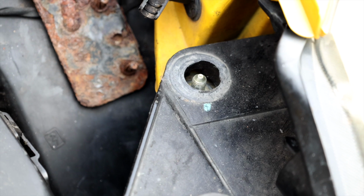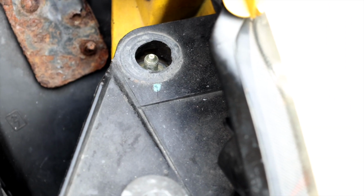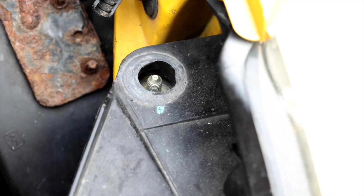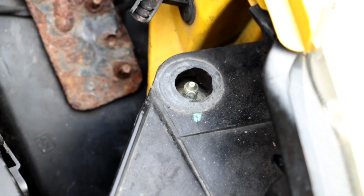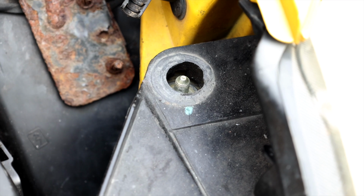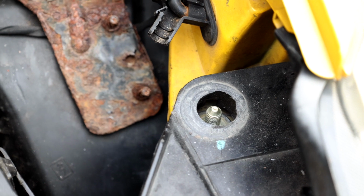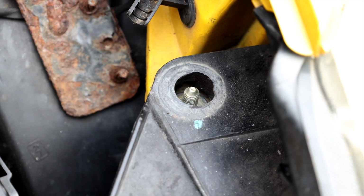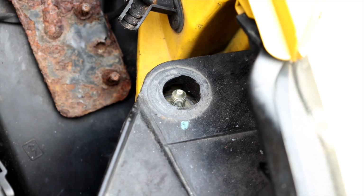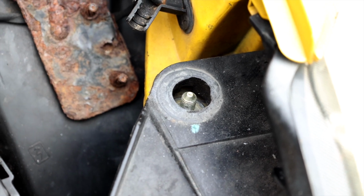Quite easily. But obviously it's not the easiest process, so if you find that you're undoing the nut and it's not coming off, don't get frustrated and start breaking stuff. Just get the 15mm underneath, hold that stud secure, because chances are it's a stud that's spinning. Thanks to a few of the lads on Facebook for advising me on that. So once that's done, it's a pretty straightforward process. You just put the rest of the parts back on. So I'm going to jump to the next bit.